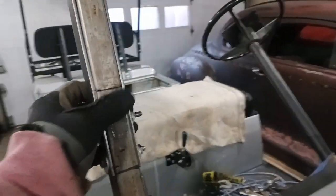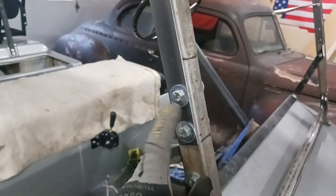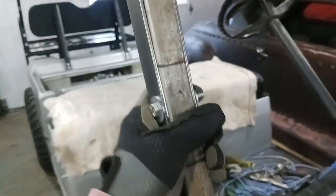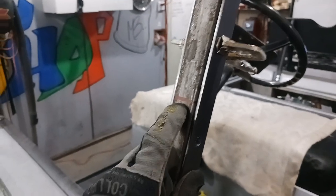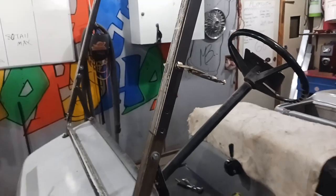Right now I have this side cut — you can see this cut right here. I put the top bolt in, bottom bolt in, and I went ahead and put this bolt in with a regular bolt instead of that pin for now just to keep this all centered up. Now that I have that side cut and hooked back together, I'm going to come over, pull these back off out of my way. I've got these holes drilled on this side now, and I'm going to cut this side with that side bolted up and all back together. Cut one side at a time.